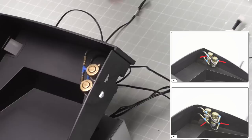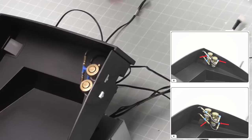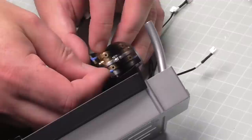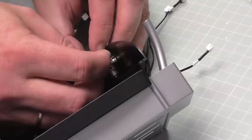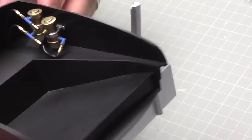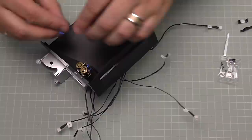Fuel pipes 3 and 4 look pretty much identical to me, but they're going to go into the ends here. The blue section is plugged into the side of the fuel pump. I'm going to put the black end in first and then put the other end into the hole in the side of the fuel pump. I'll do the bottom one first — that's easier. That's the bottom one in, and then I'll do exactly the same to the top one.